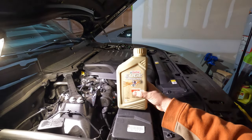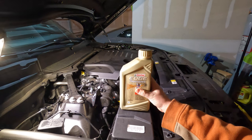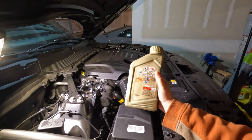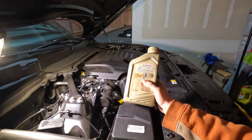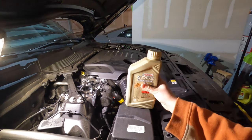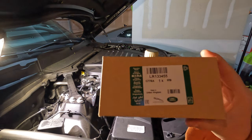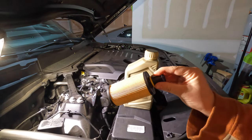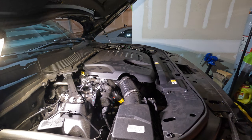When it comes to oil, Land Rover only uses Castrol Edge Professional — this is 0W-20, which is what's recommended for this Range Rover. You can find this on Amazon; they only sell it in one-quart bottles. You're not going to find this at Walmart, AutoZone, or Advance Auto. You're going to need 9.3 quarts, so I had to buy 10 bottles. For the oil filter we're using a factory oil filter — I'll put the part number in the description. This comes with a filter and a new O-ring for the filter housing. To get to our oil filter housing we're going to pop the engine cover off.